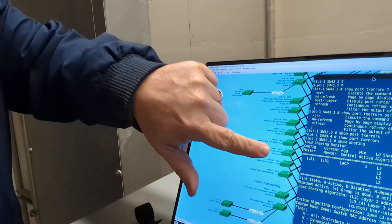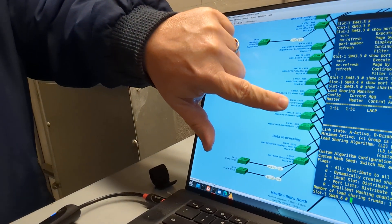So this morning I had this little ritual I go through where I check the network and look for any links that might be down. And this morning I noticed one that was down — let's see if I can point this out. That switch right there was showing as down. So I look at it and sure enough the link is down all the way back to the core switch. I'll normally log into the core switch and check a port for link flapping, and I have a command that shows me all the ports that are down due to a link flap. There were none down.